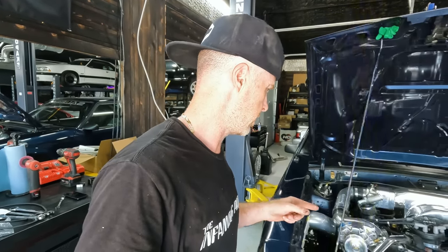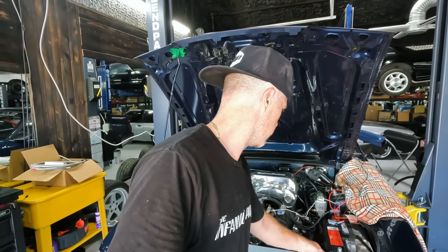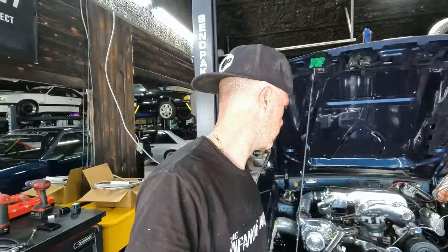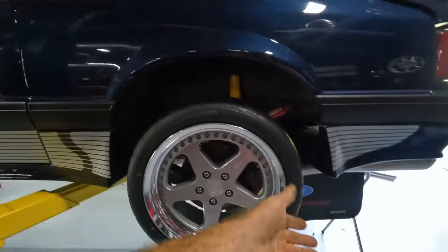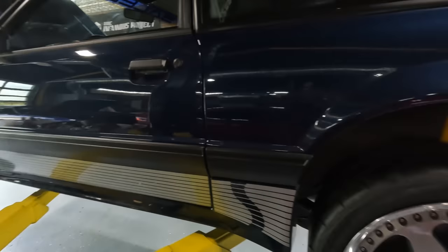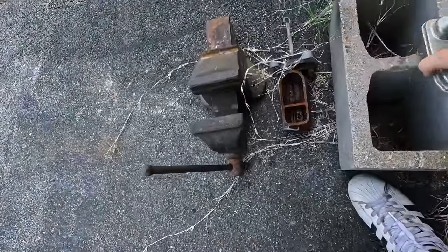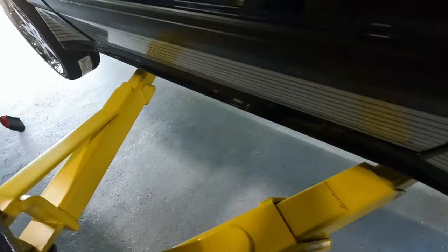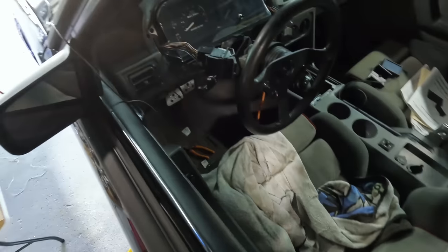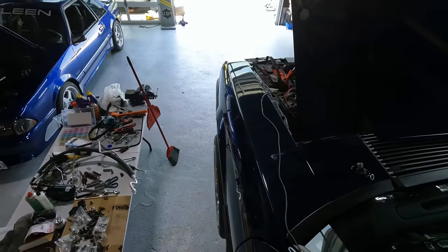I'm going to go ahead and make sure we got top dead center, pull the distributor out, do some oil pump priming, and hit the key. All right, guys, climb up in here now, bump the key a couple times before I commit to bolting the tank back up in there. Give myself a nice step. Oh, I disconnected the battery. Damn it.